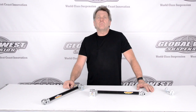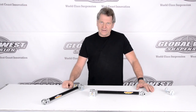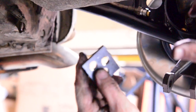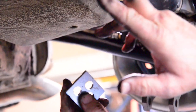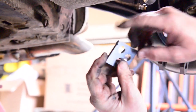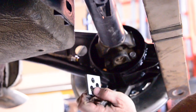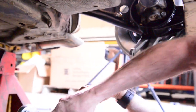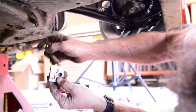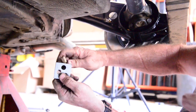We're putting a Corvette together in our shop — it's a little noisy — so let's take a few minutes and see how this goes on. We build these with a lockout and there are three holes in it. This allows you to shift the block in any direction you want, whether you need to pull it in to get more adjustment, or out, or keep it in the center. How we rotate this block determines what we're doing with the alignment. I like to keep a lot of threads here, so we start off in the center — you can see by rotating it, this is more in the center of the plate versus offset.